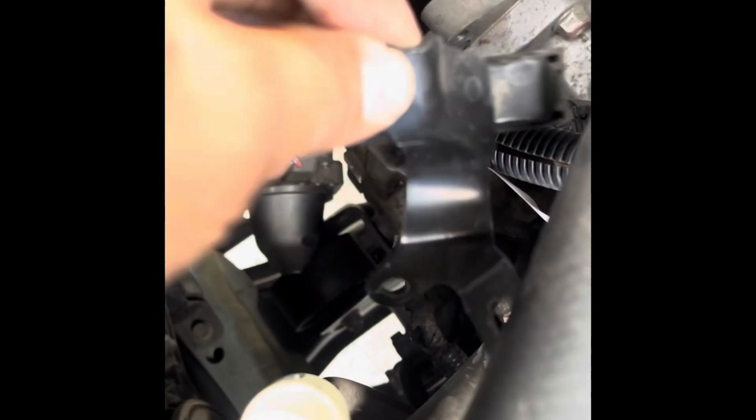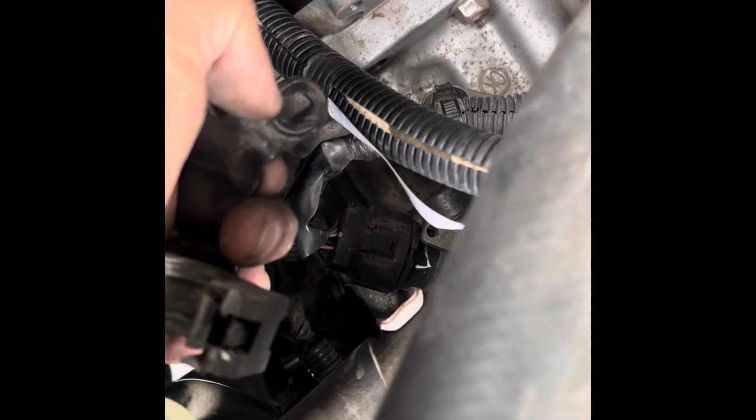So once you hang it down, it's not going to go down. There's this piece of metal which goes on the top of the throttle here, so you have to remove these brackets to make sure that falls down. It was like this, it was holding that starter motor positive wire. So you unplug that and then unscrew that bracket from there, and we'll hang it down.